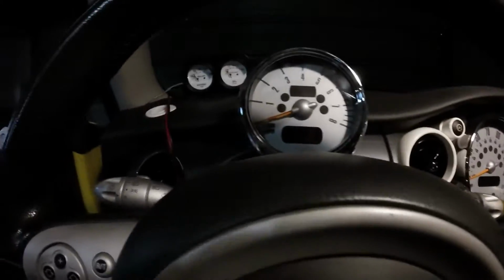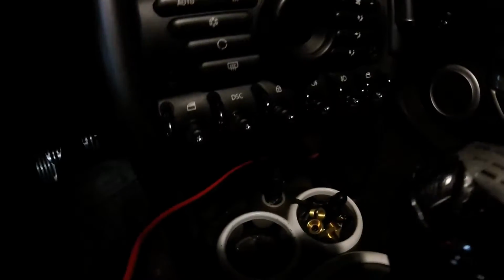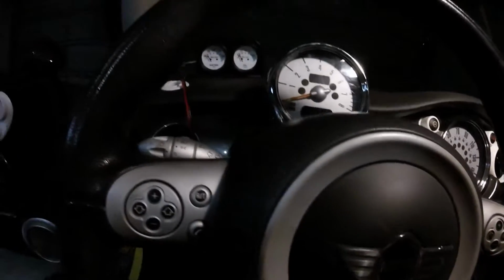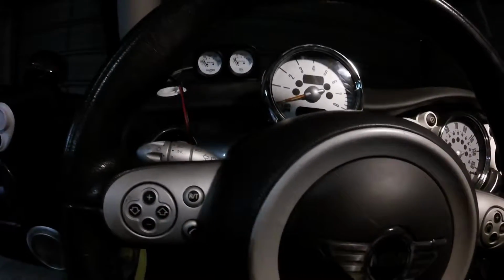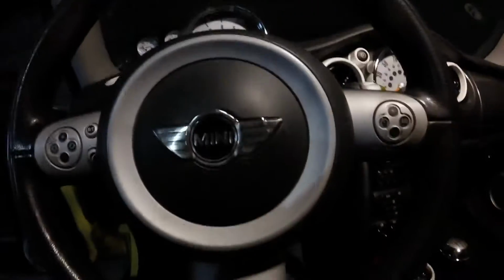And the behavior is excellent on this vehicle in that the lights turn off as soon as you turn the key off. Some cars aren't going to do that. Some cars are going to have a constant power here, or maybe a constant power for some time after the vehicle shut off. So be paying attention to that, because you don't want to drain your battery just because you hooked up these lights in this fashion.